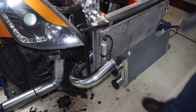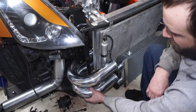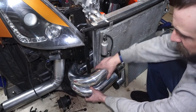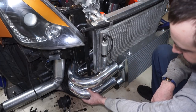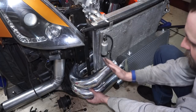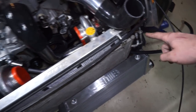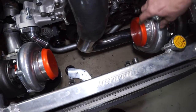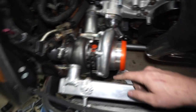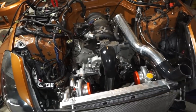The overall idea down here with the two pipes: this one's coming out of the top turbo, and then that other pipe is gonna come out pretty much right next to it. I'm going to have to angle up or cut it to come up because of the spacing on the intercooler. They're gonna come over into the intercooler and then the single one I'm just going to wrap back around and connect right here. So the driver's side turbo comes right over the front underneath the other one, the two pipes come out through the intercooler, back around this side into that pipe into the intake. That's it for this one guys, thanks for watching.